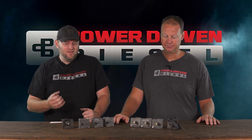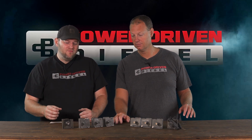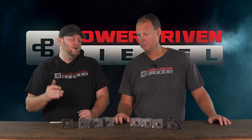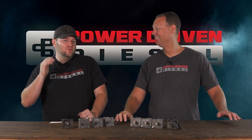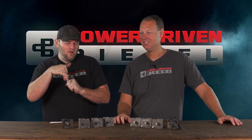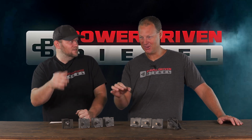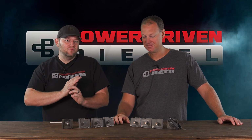The other problem we're having on your truck, and this all comes from racing, is we kept having valve cover leaks because these rock so hard. That moves the valve cover and makes it leak. So then we got a billet valve cover that tied all six together, and then it wallered out and loosened the threads. It actually ruined the billet valve cover. It rocked so hard. Basically, these things flex a ton.